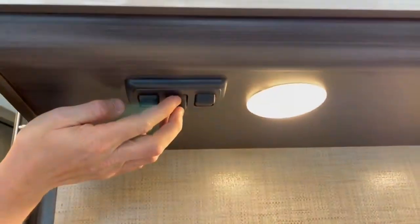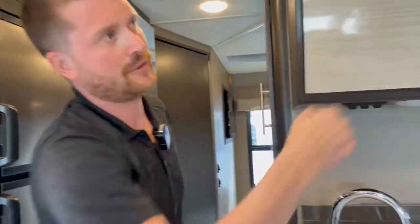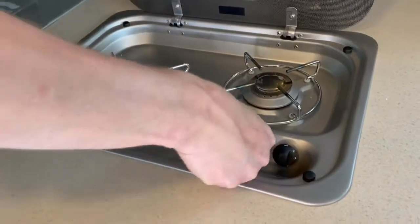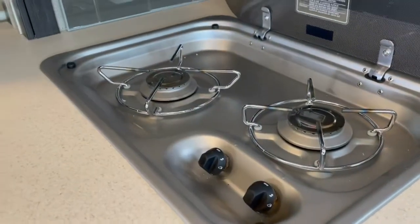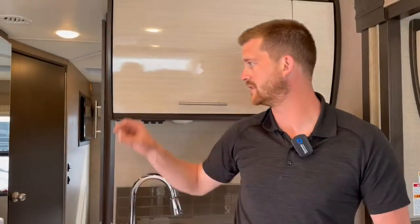You've got some light switches hiding under this counter, so if you're looking for some of your light switches, you'll find them there. There's another one hiding over here for the lights above the dinette table. Your stovetop is a gas stovetop — light these individually with a barbecue lighter. Good practice: anytime you have your propane bottle refilled, the first thing you should do is come into the RV and light both burners. Once you can get both burners lit you know you've bled any air out of those propane lines, and then your automatic appliances like your fridge, furnace, and hot water system will have no trouble lighting up.